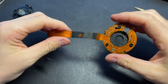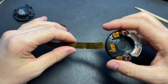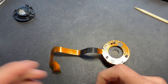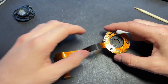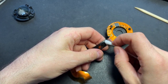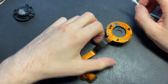I have disassembled this camera already and cleaned the flex cable. What I can tell you is this paint is not removed with alcohol, as I mentioned in the beginning. As you can see, it's not removed, so you can use alcohol safely — the reason the paint came off is because it was already damaged by glue.